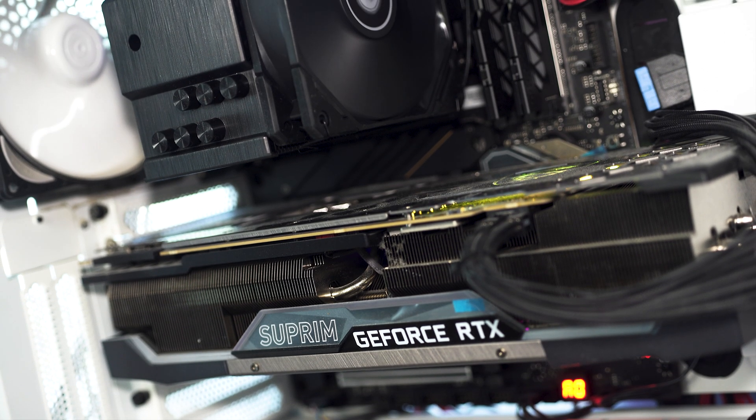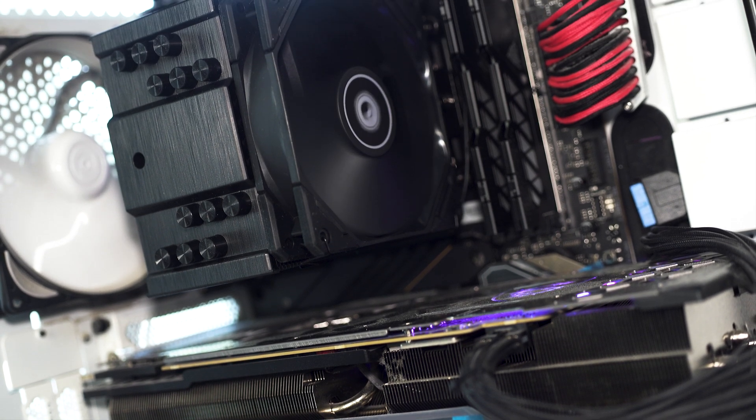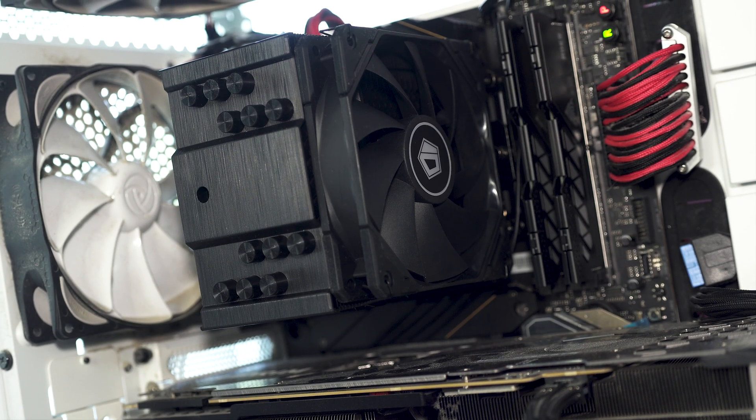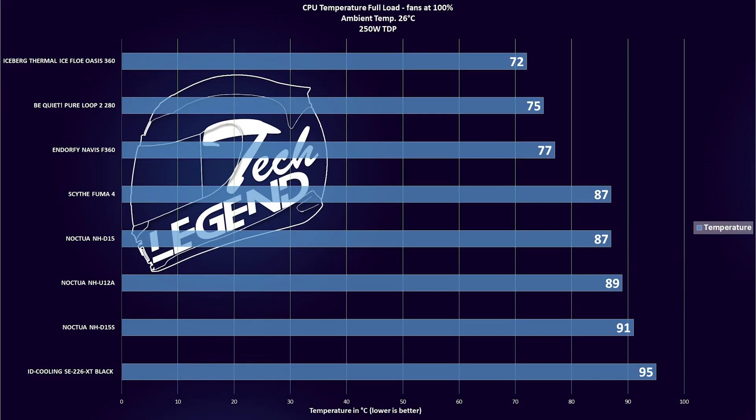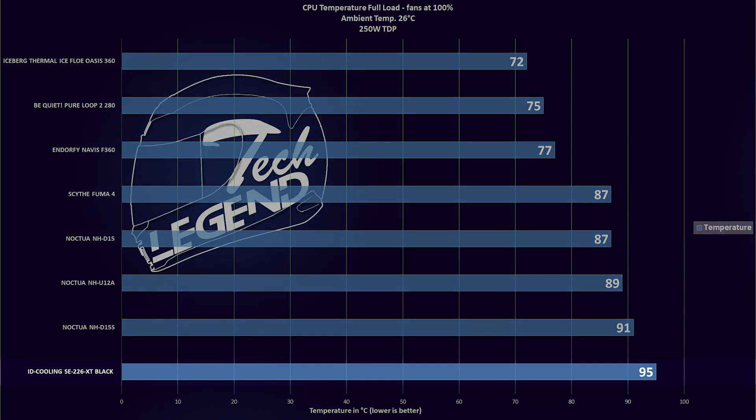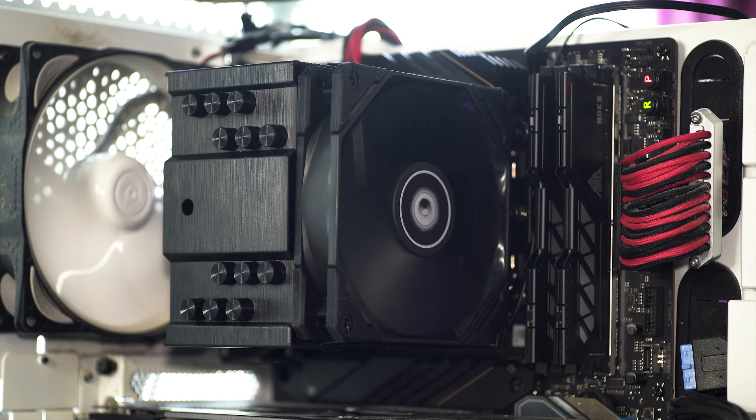The testing system used in this review has as its centerpiece the Intel i7-13700K CPU running at the factory turbo boost frequency. The ambient temperature is fixed at 26°C (78.8°F). With the CPU running at its maximum frequency and 250W TDP, it reached a maximum temperature of 95°C. This is not surprising, as this CPU is power-hungry and you usually need a liquid cooler or a massive air cooler to keep temperatures under 90°C. While not at the top of the chart, this CPU cooler performs well, and importantly the CPU did not hit the thermal throttling point — something not many air coolers can achieve.